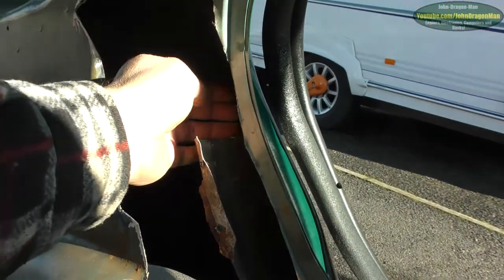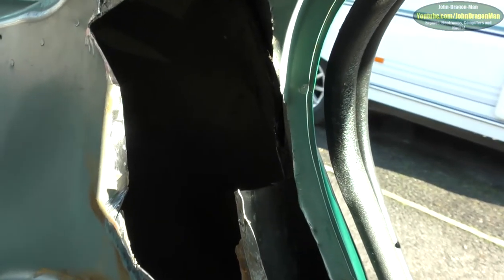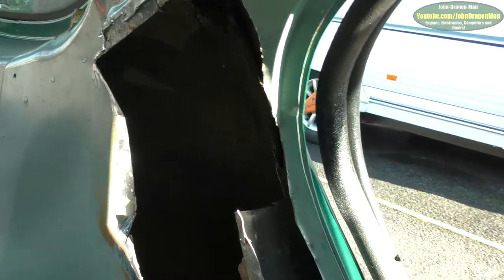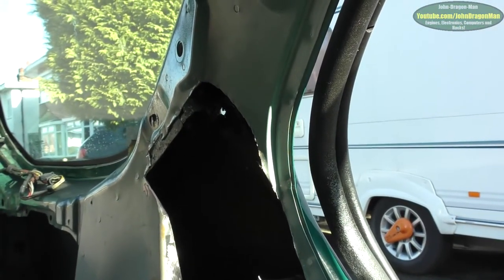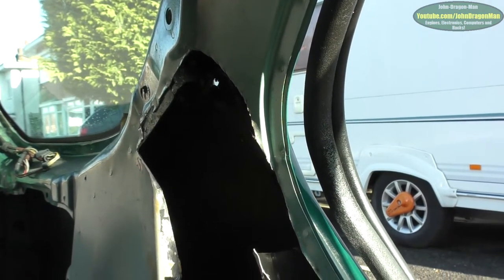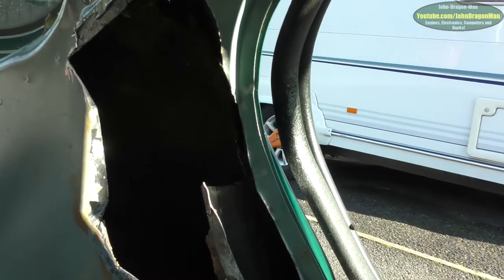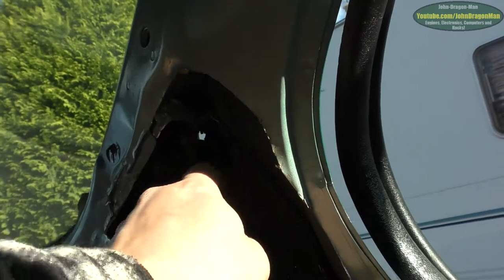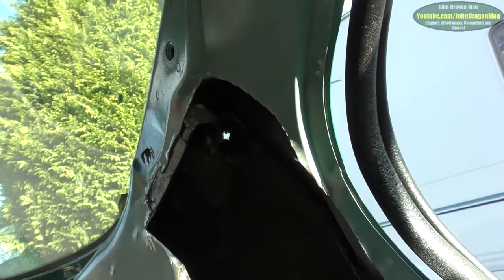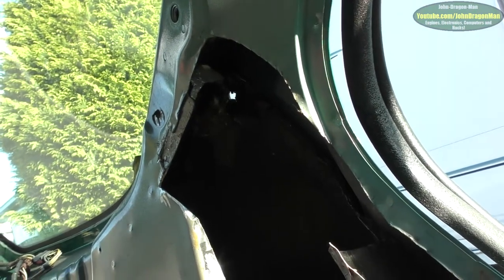I'm going to rebuild this back up again. I've managed to cut all that out relatively nicely. There's still a little bit of rust at that part there, but I'm just going to have to blow holes through that and keep filling them, because I can't go down any deeper. What I don't want to do is get to the point where I'm causing scorch marks on the paint on this side of the car. I've got that bloody hole there I've got to fix, and the only way to do that is to cut out and weld in — hopefully I can do that with a die grinder or small grinding wheel, maybe even a Dremel, just cut a small square out and weld a patch in. I'm going to be very naughty and cover most of this rust up — wire brush it all down the best I can. I've got some rust converter on it, which turns it into iron phosphate or something like that. I put some rust converter on it from when I did the Fiat Panda.